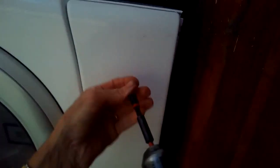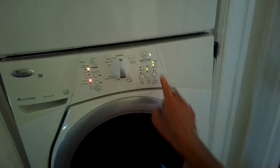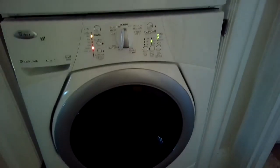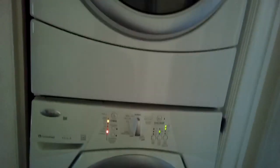So I'm putting the front panel back on, pushing it in really hard with the heel of my hand to lock it in, and I'll put those two screws back in. Putting this whole thing up on this little plastic case definitely helps you to get into where those screws are — otherwise it's kind of hard to do. I'm doing the same thing — trying to get it to drain early in the cycle. On these machines, if you press the spin speed button to the highest speed and then press start, it'll activate a drain cycle.